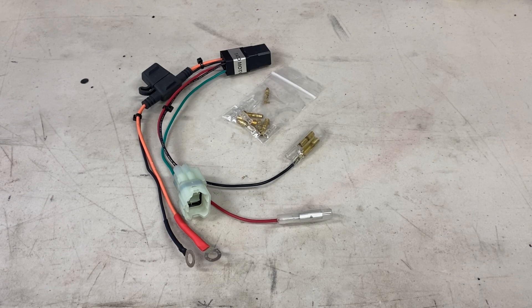Today I'm going to walk you through installing our new release accessory relay. This is a power harness relay that will operate any of your downstream electrical components that you only want to have energized in an engine run state — not key on, engine run. The motor has to be running and the ECU signal has to be in the run state for this relay to activate and for those accessories to be powered.